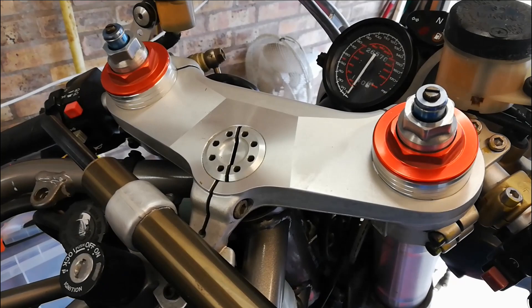Today I was going to take the rear hub eccentric adjuster apart and grease the bearings in it, but I need a 41mm socket I don't currently own, so I shall be sourcing that in the next couple of days. So today instead, I'm going to take the forks out, check the headstock bearings, re-grease those, and strip and rebuild the forks.